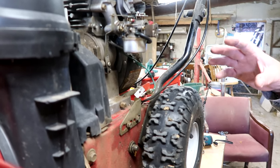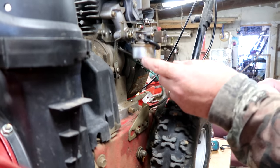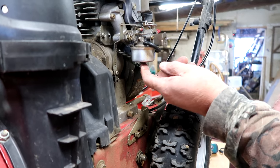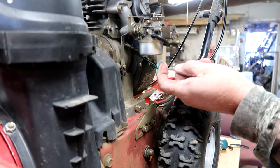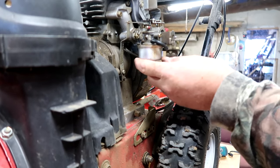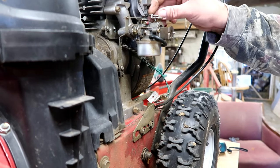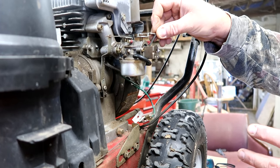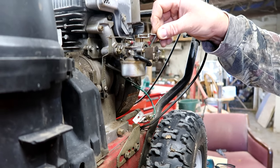This video is not about a snow blower, it's not about a Tecumseh engine, it's about a problem with small engines. But this is the carburetor, and there is what's called a jet in there, and it feeds the fuel up to the throat of the carburetor. I suspect that it is clogged a little bit. That's why it would run when the choke is on, but when you take the choke off, it's not going to run.